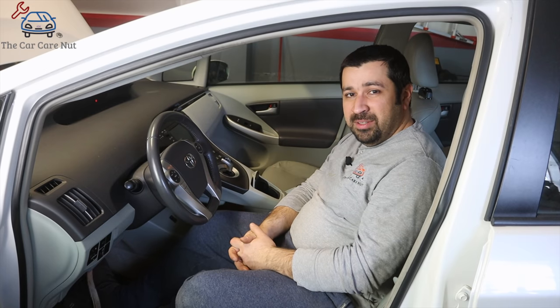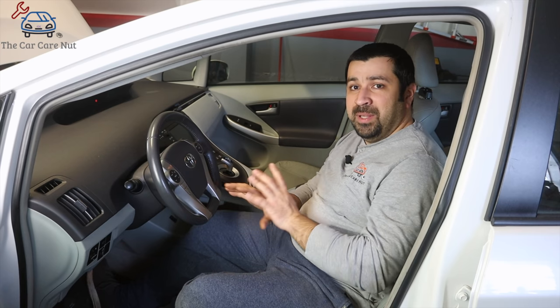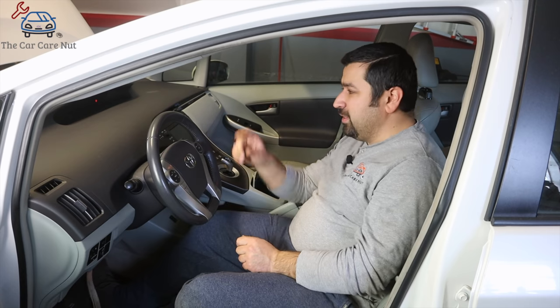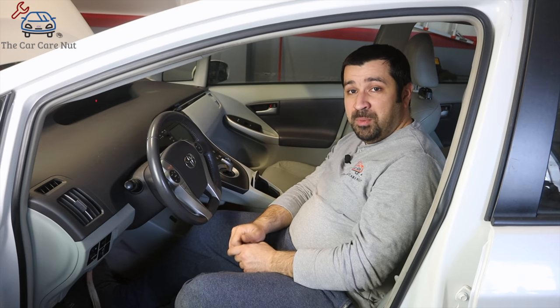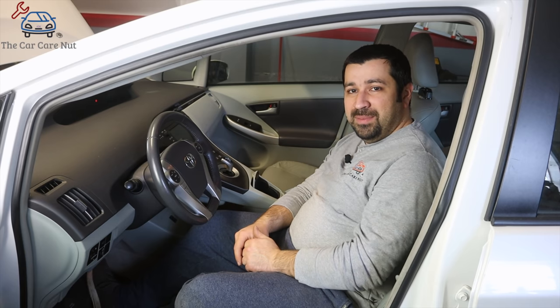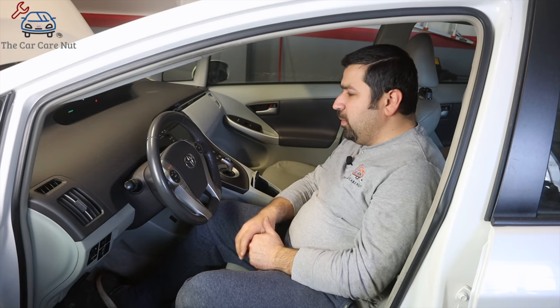Let me show you how to put your Toyota hybrid in maintenance mode. This procedure applies to all hybrid models. When you're done it's going to display 'Maintenance Mode' on the screen. The only exception is the second and first generation Prius — they'll display an exclamation mark on the radio screen. In maintenance mode the engine will run continuously. You can drive the car for very short periods for diagnosis purposes, but never drive in maintenance mode all day — you'll cause serious damage to the hybrid system. You can keep it running stopped as long as you need for diagnosis.